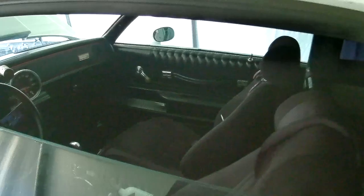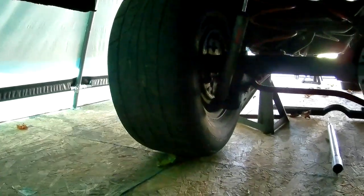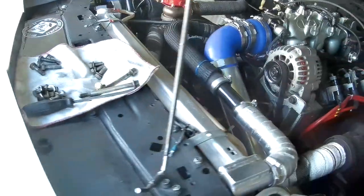Car does run on E85. It's got two AEM 380 pumps back here. That Y's up into an AN-8 feed, AN-6 return. Running the Nitto NT555R radials on it, and it didn't do too terribly bad this year, but it wasn't leaving on a whole lot of power either. So we will see how all that works out, hopefully this coming season, as long as I can get the transmission back in.